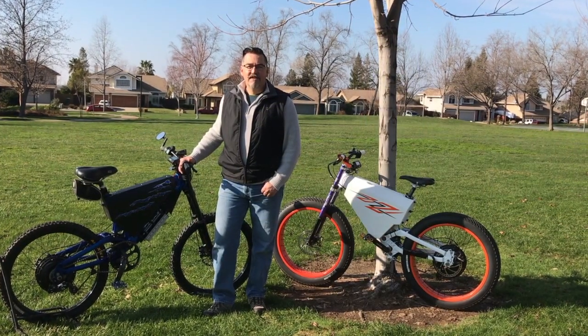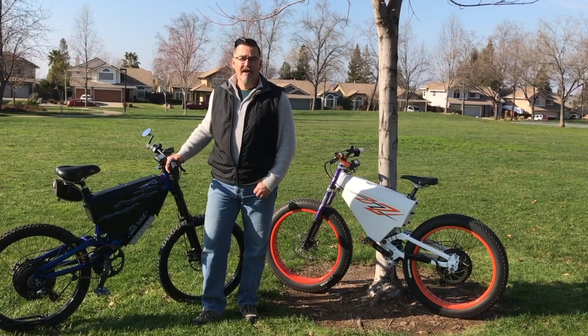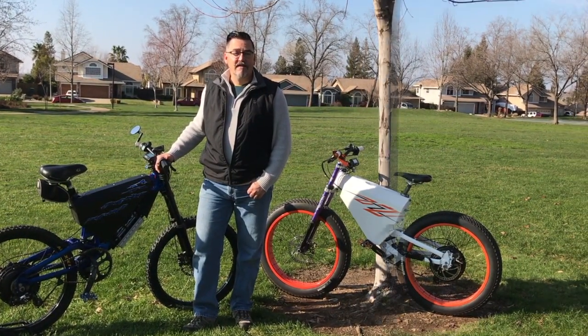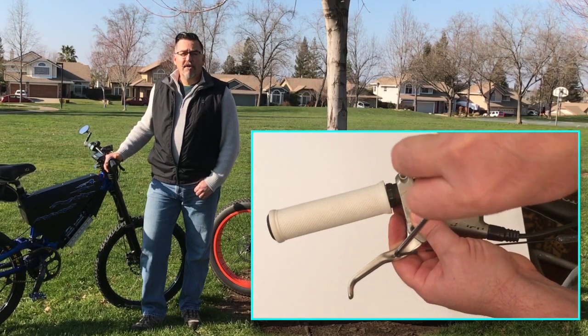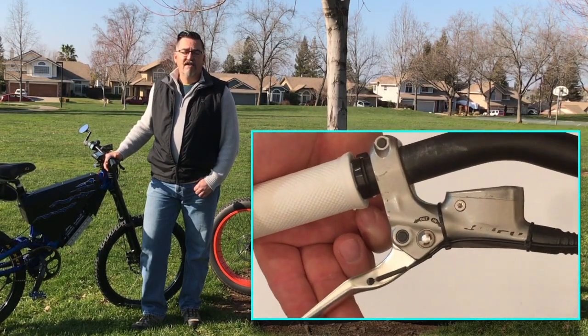Tripwire installation provides a very tidy and reliable brake sensor that lets you leave your original brakes on the bike, or add high quality hydro brakes to any bike. Here you can see it installed on my own e-bikes. The Tripwire cable is screwed into a small hole in the lever arm. When you pull the brakes, you can see that it pulls the Tripwire and activates the sensor.